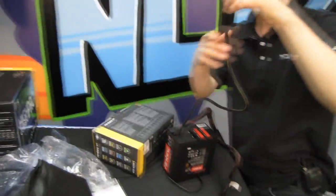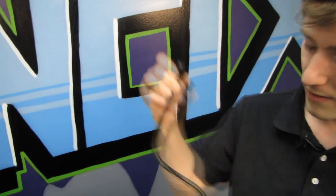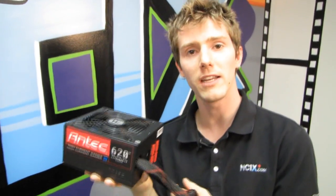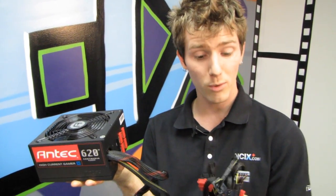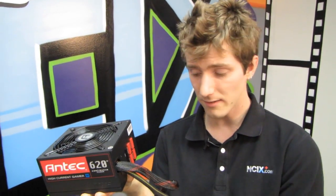And finally, a nice long four-plus-four-pin cable — about one Linus arm length — good for your CPU power connector. So this is a 620-watt power supply: you won't be powering any high-end dual graphics or dual CPU configurations. The one thing I wouldn't mind seeing improved is maybe one more SATA connector, but other than that it's not the end of the world.